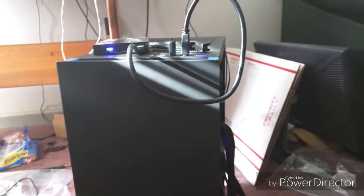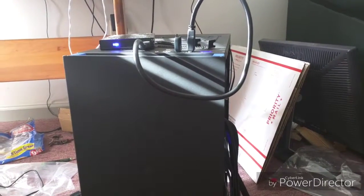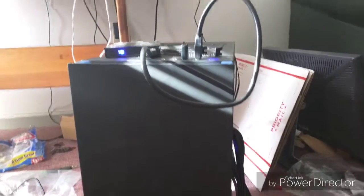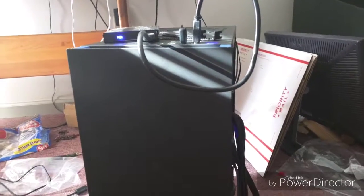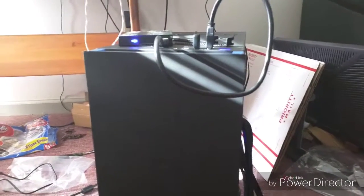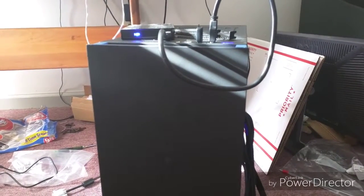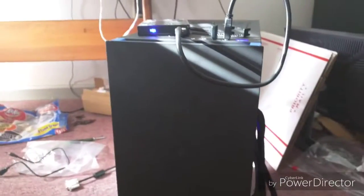Now, a couple of complaints that I have is I feel like the motherboard backplate might be a little bit on the thin side. So when you're cranking down your motherboard standoffs, you want to be extra careful not to strip your threads. I almost did, but luckily I have a tap that I was able to use to fix that right off the bat. One of the things that I really enjoyed with this case is the amount of struggle of installing my components was so darn low that from here on in I'm going to be using NZXT cases regardless.